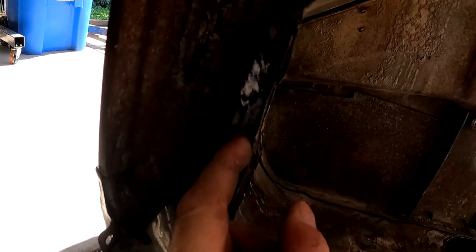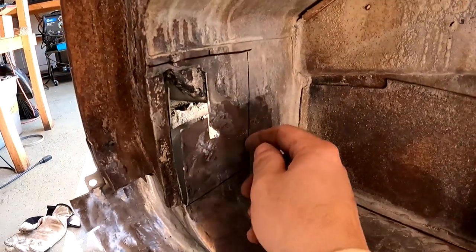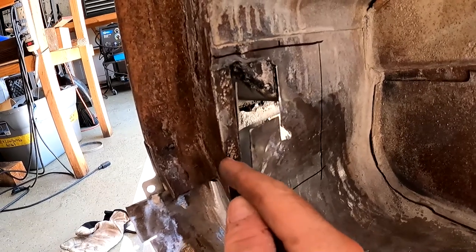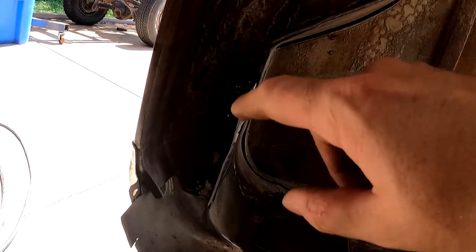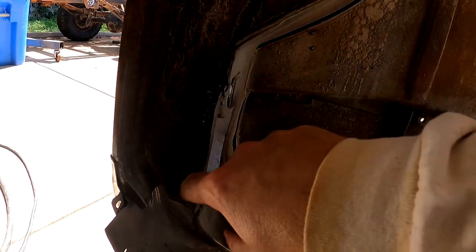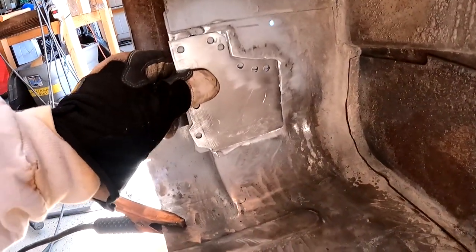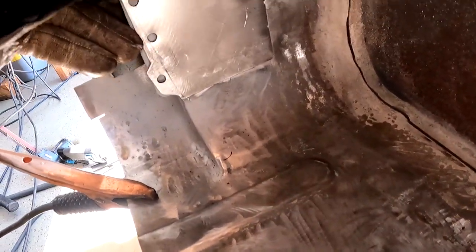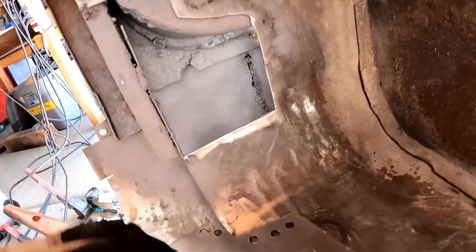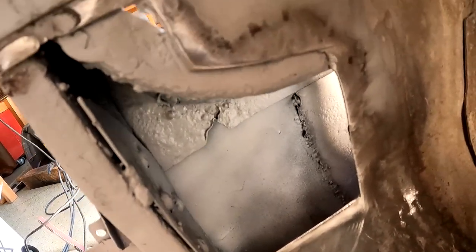There's a few rust holes in the rail that I need to weld up, but the big one is this section right here — I'm going to replace the original. I had kind of a little tab right here to line it up, so I'm going to put that back in. I filled up a whole bunch of rust holes in the rail right here, and I've gone ahead and cut my piece with the spot weld holes ready. There's this little tab right here like they did stock — when it wrapped around this rail there's a little locator tab right there. I've also gone ahead and sprayed the inside of this cab corner with primer and rust sealant one more time.